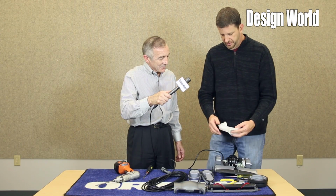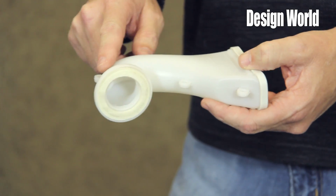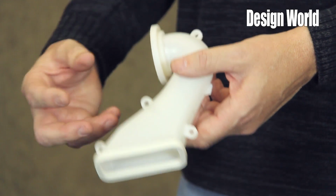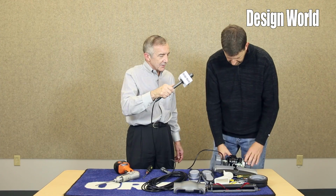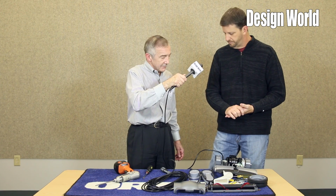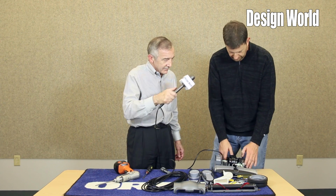The inlet, again, with a lot of this tight bend, this was another challenge for us, because the front part is a blow molded part, which is a type of plastic forming technology. But you can't form this part on the end. This part on the end has to be individually molded, and then it's spin welded to this. I would think you'd have to model that air path too, because that's quite a sharp bend. We did fairly extensive CFD design work while trying to optimize this package. It was that balance between optimal efficiency for the air path and optimal efficiency for weight. So we balanced those two out.